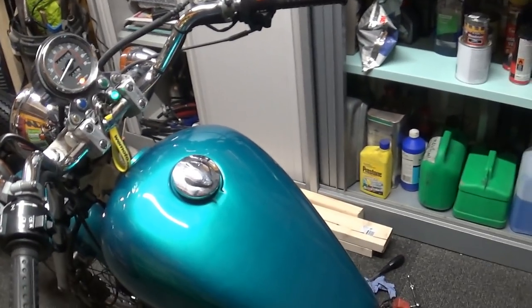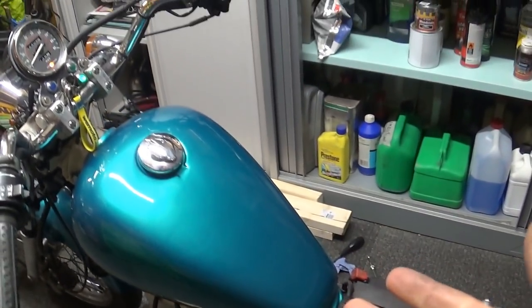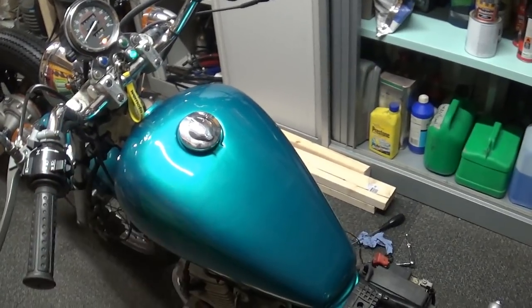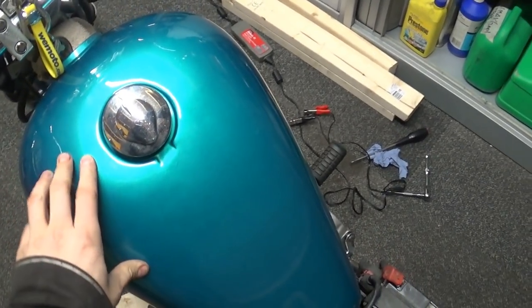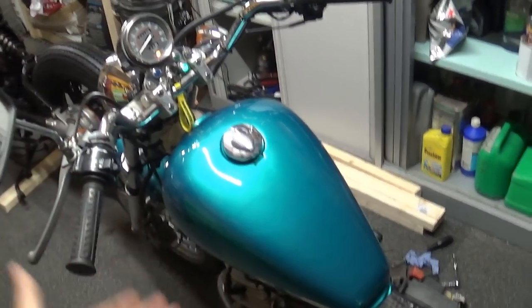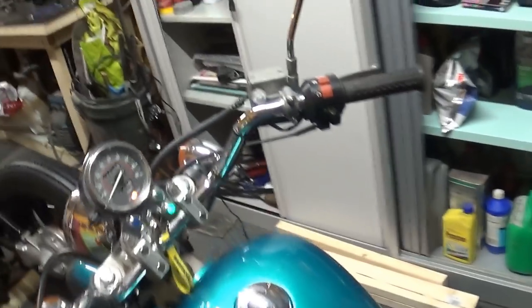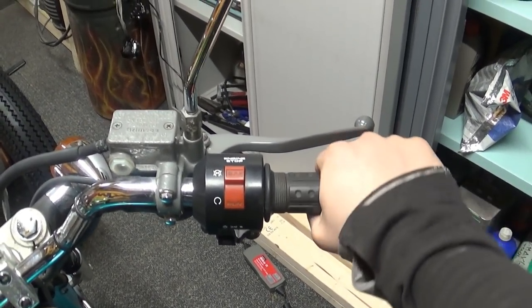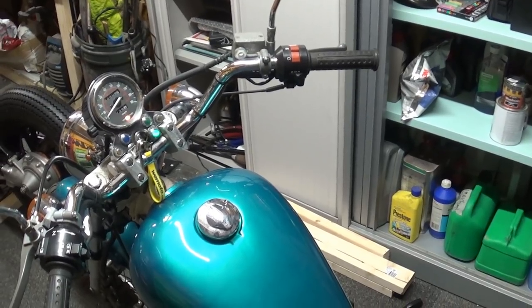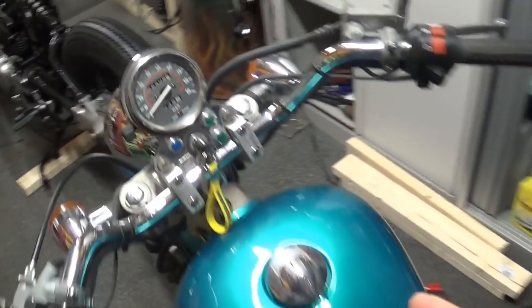It was running slightly better with fresh petrol. A small-cylinder bike like this is going to be sensitive to good quality petrol. Lots of you suggested the petrol was four months old — those modern biofuels aren't exactly great for sitting around that long, it goes stale. Doing it gently the revs are absolutely fine, but if I want to yank on it, it stalls — as it just did.